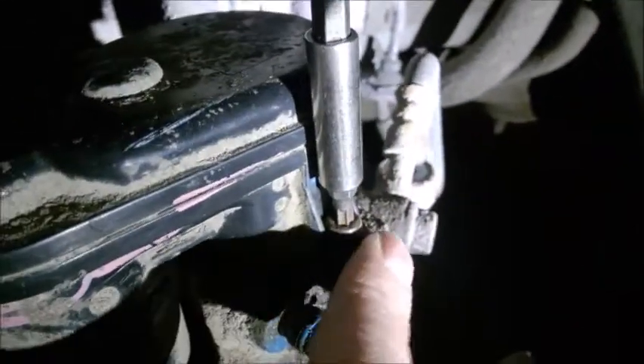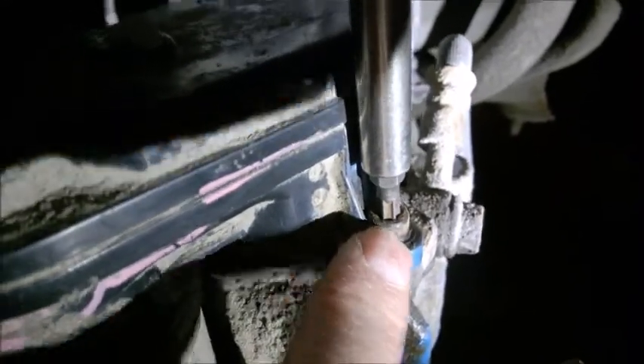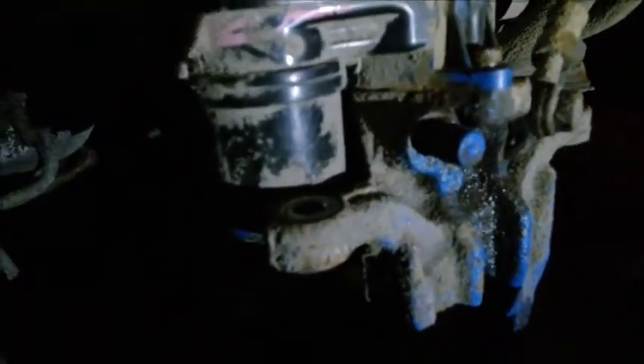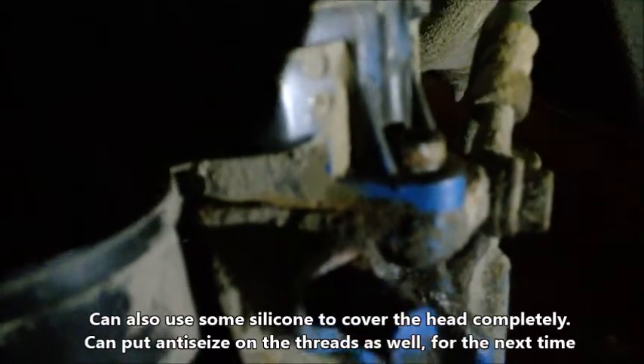That's a big warning — there's a second screw on the other side. Really, do not put a T25 torx on these guys, and try to get a good quality bit. Also don't over-tighten this bolt when putting it back — you want to remove it easily next time, just give it a small snug. The motor will not jump from there; it's just to keep the motor a little bit in place. When you finish, I really recommend applying some anti-seize and filling the head of the bolt with it to preserve it from rusting again.